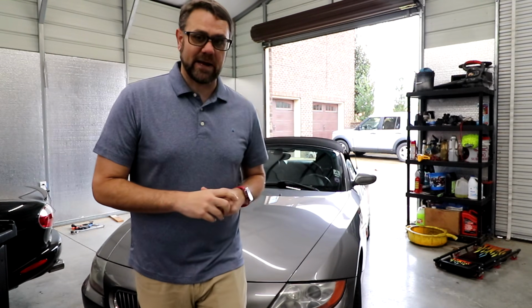Well, it's been over 5 hours of use, and that means we can finally do the final inspection and see if the Z4 leak is still there or if AT-205 actually did its job. Now, I would have put this up on the lift and made it easy on myself, but I've bought another project that you guys will be seeing very shortly. So what we're gonna do is just move her back a little bit, jack her up, and take a look underneath. The first thing that we're gonna look for is if there's any oil sitting underneath it now. Let's back her up.